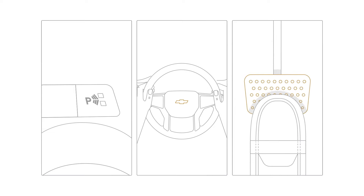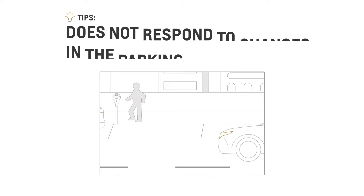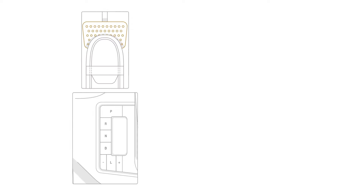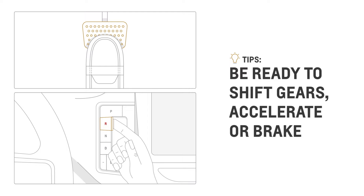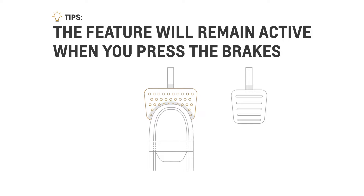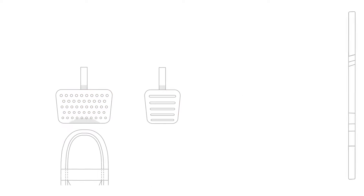While this feature can be very helpful, there are some things you'll need to remember. Automatic Parking Assist does not respond to changes in the parking space, like the movement of a vehicle or a person. You should always be prepared to shift gears, accelerate, or brake as needed. The feature will remain active when you press the brake pedal, unless it's pressed for an extended period of time.